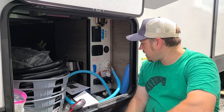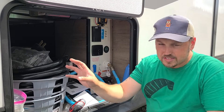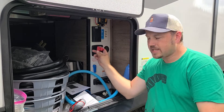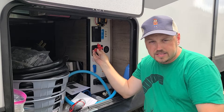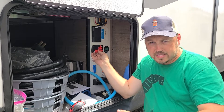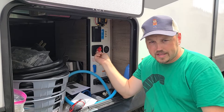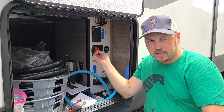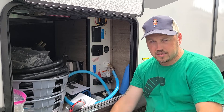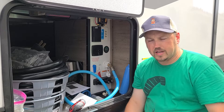Right now I'm working outside — you can see the battery disconnect is off; we'll come back to that in a minute. I have my batteries on the front of my tongue and a disconnect right there. What does this disconnect do? Well, it shuts off the 12-volt lights inside, the radio, and the display panel at the top of the steps that shows your tanks and battery. But it doesn't shut down the whole system — it pulls select things offline that commonly drain your battery, while leaving on your tongue jack and your propane alarm, which is a safety feature.